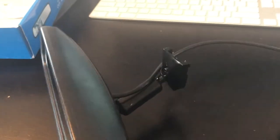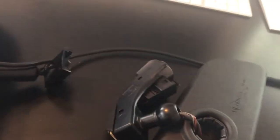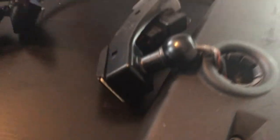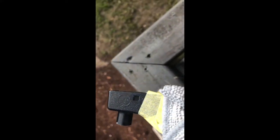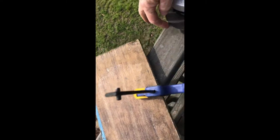I don't like this post that connects the new rearview mirror to the windshield — I'd rather use this one from the salvage yard and put the covers over it so it looks stock. We're going to cut it right here. This diameter is 13 millimeters and the other one is 19 — we'll cut this one and put it into the other one, then secure it with a screw. Using the cobalt cutoff tool — actually a Dremel since the blade width is about the same — gives a very nice cut.